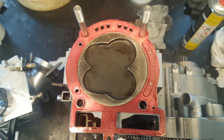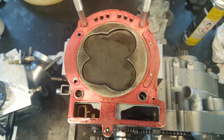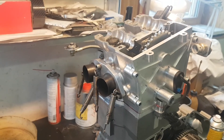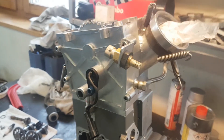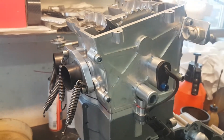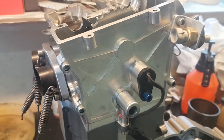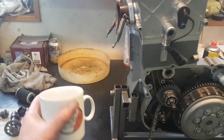So I made sure that all surfaces are extremely clean, and then I put the head gasket in place very carefully because it's very soft. There it is in place. The bolts are tightened to 45 Newton meters, which is a little bit over stock spec, but I have found it necessary to make this copper head gasket work. The gasket is 0.5 millimeters thick. And as you know, the budget in a Swedish racing team is not so much spent on this, but on coffee — so, time for a break.